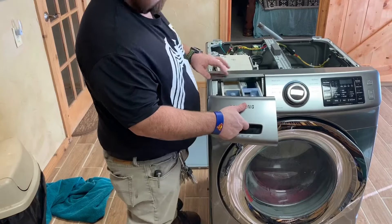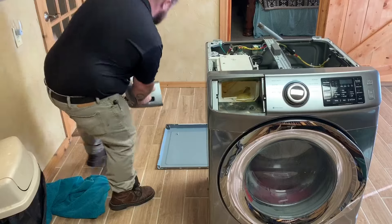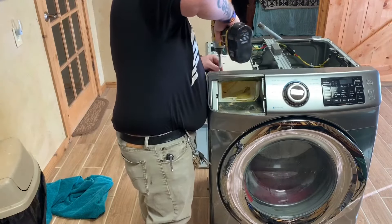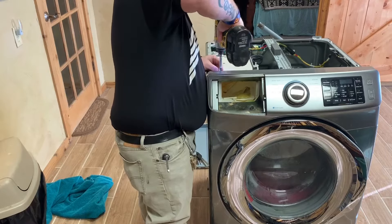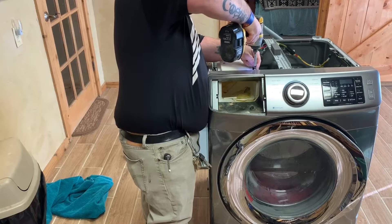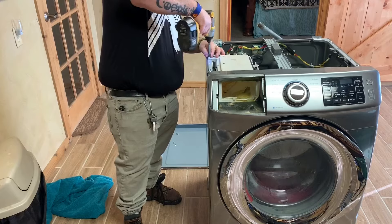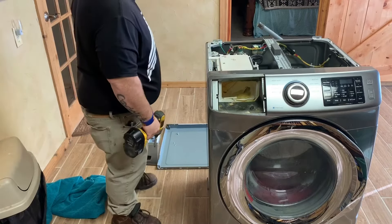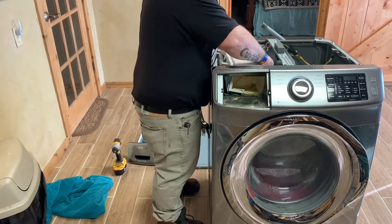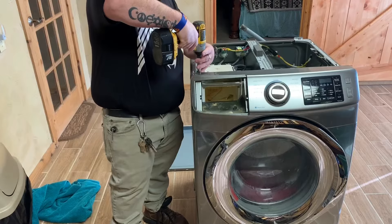I had to go ahead and close the door. Go ahead and pull out your tray that you put your soap and stuff in — take that out first. There are three screws that hold in the soap tray: two in the front and one on the actual side. After you get that loose, go ahead and put your screws down and keep them separated, then pull that out.